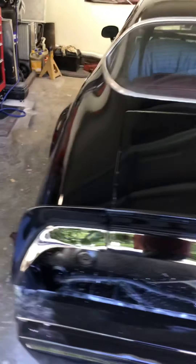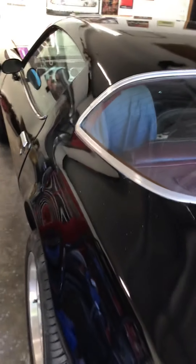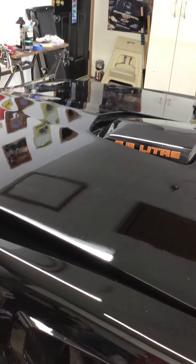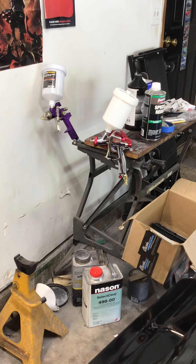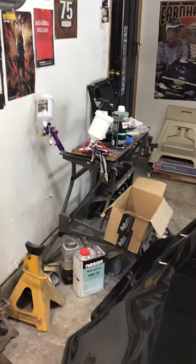From the last video, put it all back down, sanded it all back down, put on some paint and some clear. Then had a problem with my air compressor — it was not putting out enough CFMs to run the high volume guns. But I got a new gun; it's a low pressure low volume gun and it worked fabulous, fabulous, fabulous, as you can tell.